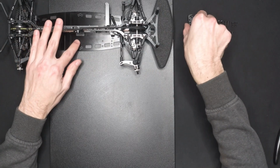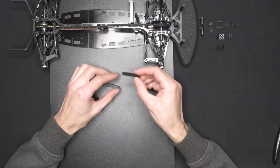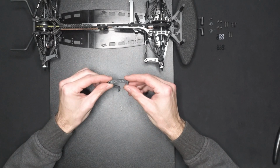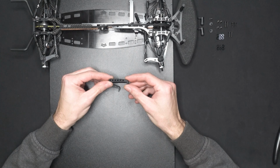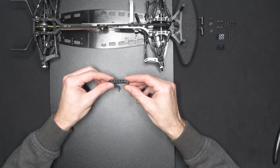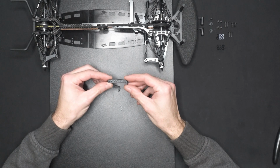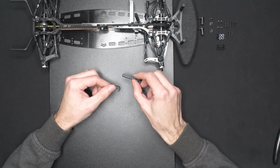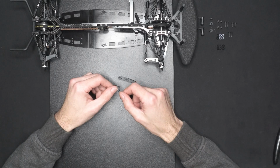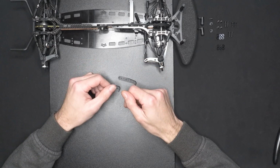Moving on, let's install the battery hooks. Included in your kits, you'll find these P23R plastic hooks. They are the most lightweight option available, and therefore are perfectly suited for the heavier kind of batteries used in stock class. So for 280 grams or above, they are actually perfect. For lighter battery types, used either indoor or modified like ULCG or Shorty, then you'll need the optional brass mounts.